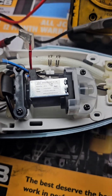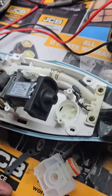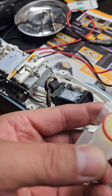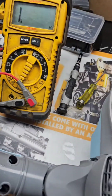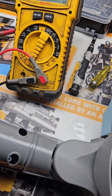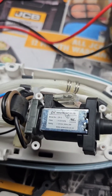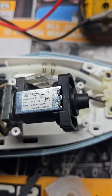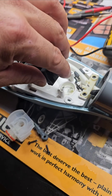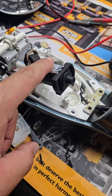I'm going to try to take this little pump off. This guy here is a little pump - a pump that ain't pumping. You can see there's water - that's dirty. This was on there face down like this. When this turns on it pumps up the water, shoots it through here. But this thing isn't pumping. I turned it on real quick to see what it does in this state - this pump is doing nothing. So this is the issue right here.